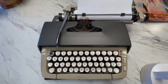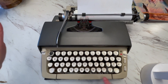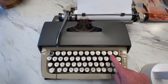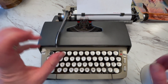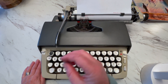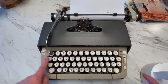For tabs: I have one set, but to clear it, you just hit clear right here. Hit tab and it should be cleared. To set a new tab, move the carriage to where you want it and hit Set Tab. That's how you set your tabs. If you want to backspace, there's an arrow on the left side — just backspace one space at a time. It's not a computer. What if you make a mistake? It is not the end of the world. You can X through that line or type over it, whichever you prefer. And that covers your space bar, shift, shift lock, margin release, tab, and backspace.